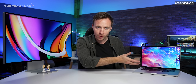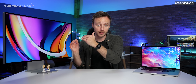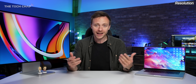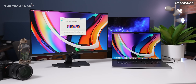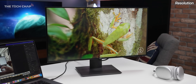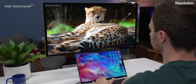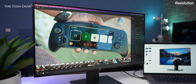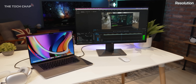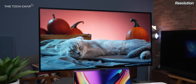Resolution matters — you don't want to pair your lovely MacBook with a low-quality, low-res display that looks rubbish next to it. 1080p Full HD is absolutely fine on a 24-inch monitor, but anything bigger, definitely try and get 1440p Quad HD for a much sharper picture. If you need to see even finer detail, go for 4K — it's absolutely worth it for graphical or video work. Outside of gaming, where it'll destroy your frame rate, there isn't really a downside to 4K, except maybe cost.